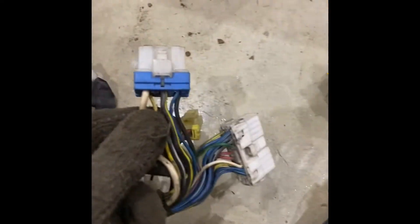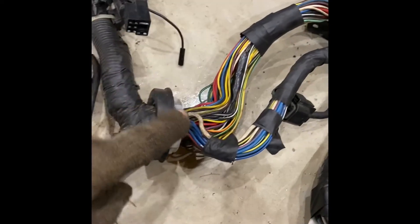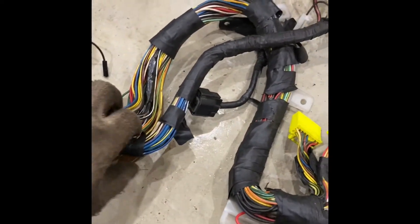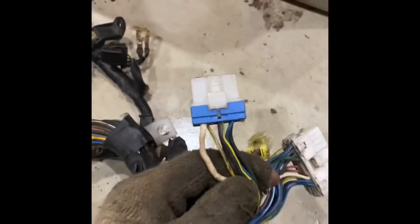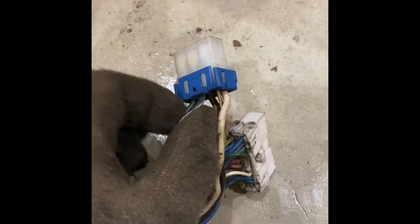Black with white — that's this connector here. We'll cruise down the harness so you can follow along; it's on the inside of the car. Right in the middle of the bottom of this connector is the black with white wire, and that goes to the ignition coil and powers up the whole harness. You need to feed that one some power — usually you pull it out and hook it up to ignition voltage.